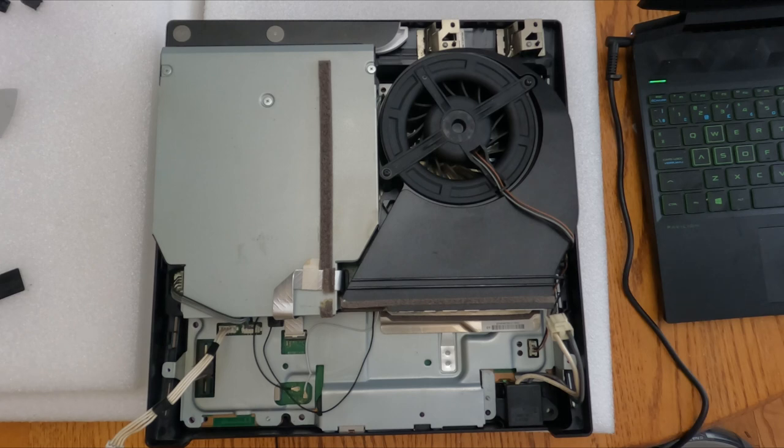Now we're with an overhead view, and I'm looking at this Bluetooth or Wi-Fi antenna connection. And it's broken. The white antenna is broken. I'm not too happy about that, but it is what it is. It broke right on that inlay for the antenna connection ports on the main board there. So this is what you can expect when you buy a console from a guy that has done servicing on the console himself. My guess is you pulled it out without removing the power supply.